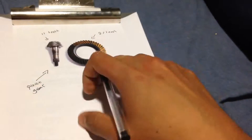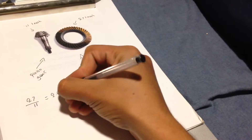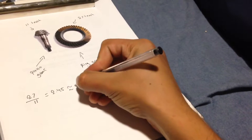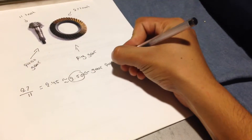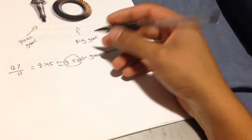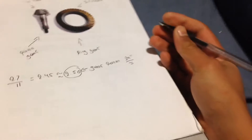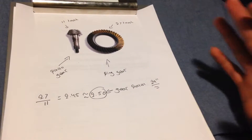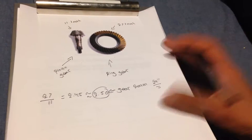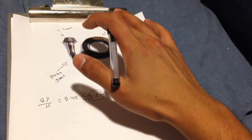To find the gear ratio of this setup, you take 27 divided by 11 and you get 2.45, roughly estimated to 2.50 — that's your gear ratio from the factory. With this gear ratio, you're running a 29-inch tire straight from the factory. Your fuel mileage is going to work perfectly, your transmission is going to shift perfectly, and your overdrive is going to kick in perfectly in fourth and fifth gear if you have an automatic transmission.